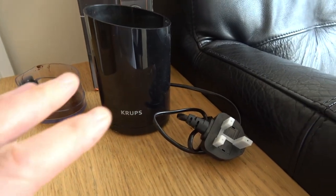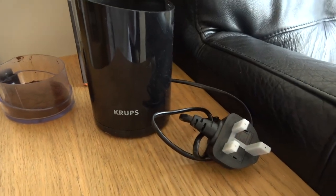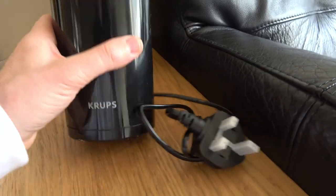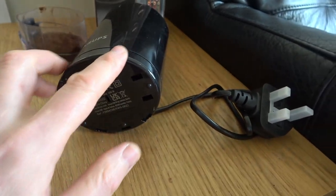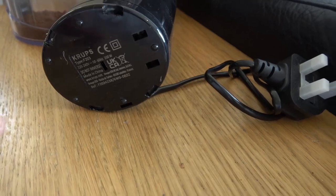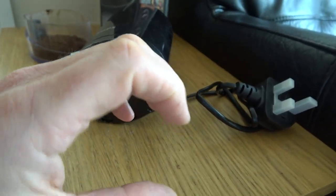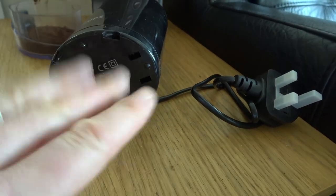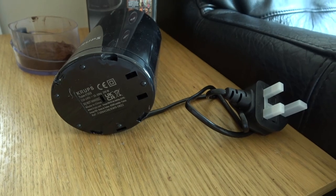So there we have it — my attempted repair on the Krups coffee and spice grinder. I'm not happy with it; it didn't go well. If only security screws had been used at the bottom it could have been taken apart and put back together nicely and safely. In hindsight, if you're watching this to repair your own, it's pot luck with the heat and clips — too much heat and it melts, not enough and they snap. What I wish I'd done is concentrate on freeing the motor shaft without even taking it apart — using a small screwdriver but with a bigger handle for more torque. I think I could have easily got it working without disassembly; all I had to do was give that shaft a tiny turn back and forth a few times to free it up.